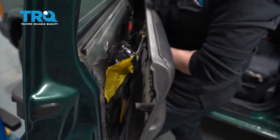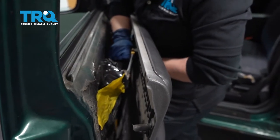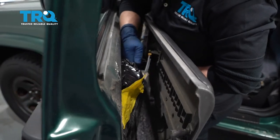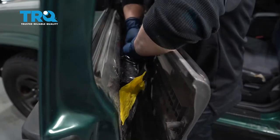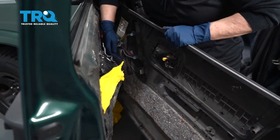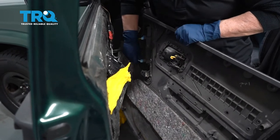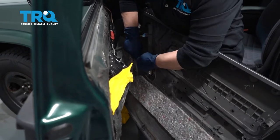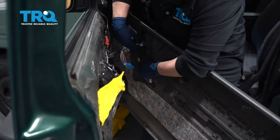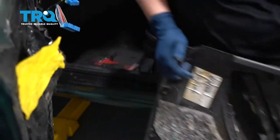Once you've exposed the handle rods — the lock and the entry — you're gonna take your thumb, push that plastic over, lift the rod up. The same with this one, and then lift the rod down. Now we see the electrical connectors for the main switch. I'm just gonna push on that tab, wiggle it out. Same with the top. Now we can get the panel out of the way.